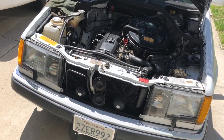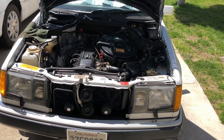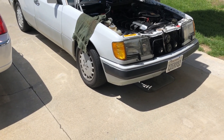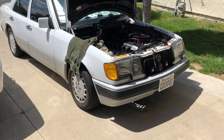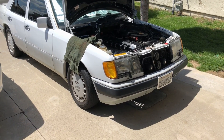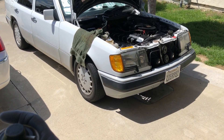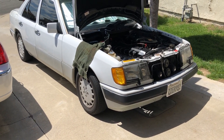My son filled his tank up about $85 worth of premium - about 15 gallons. The tank holds 18.5 gallons. He just got down to the empty mark two days ago. He had reset his odometer when he filled up and it was at 173 miles by the time it went from a full tank to empty. If you do the calculation - 18.5 gallons, supposed to get around 16 miles per gallon in the city - you should get about 293-296 miles out of a tank and he only got 173. That's pretty bad.